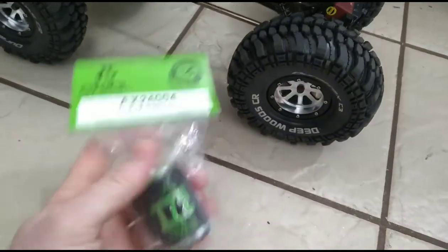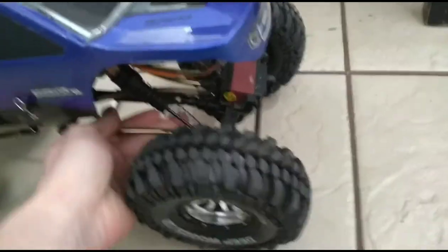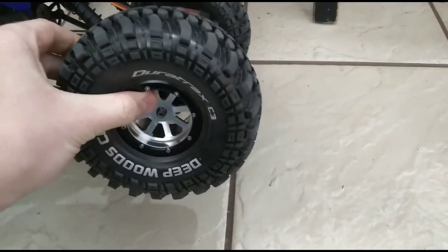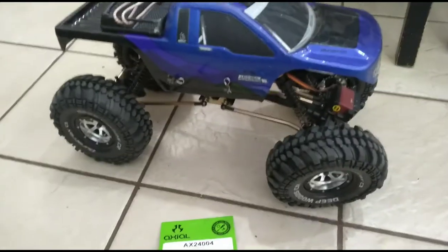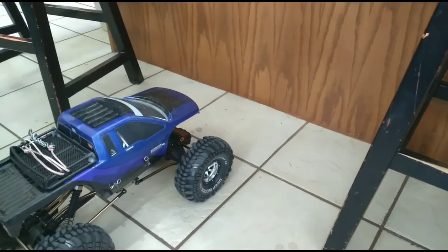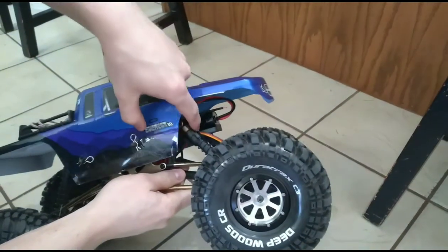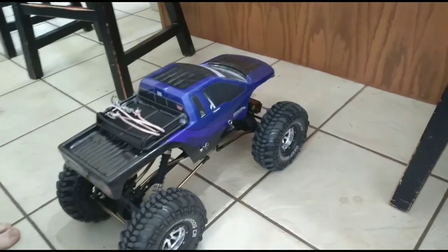But this one has a serious problem with a lot of torque. We'll show you when you drive it — it twists itself and then it raises one side up so it loses traction. So we'll show you how bad that is. We're just going to try to climb this wall here to show you how much torque it has. Also, we already put two extra spacers on this side of the shock to try to help the torque twist, but here we go.